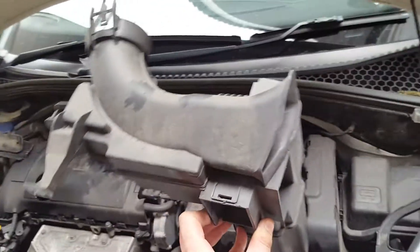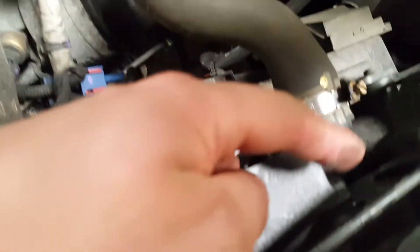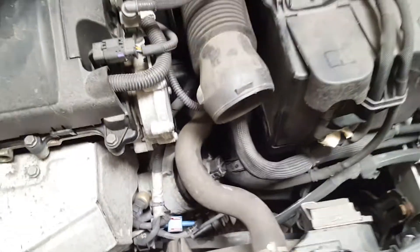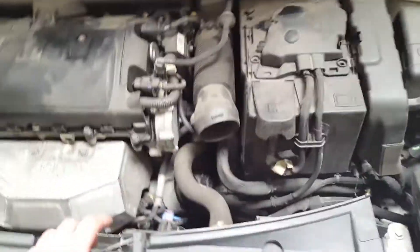The other thing is to get your oil filter, which is there — new 27mm socket on it. But first you need to remove the air induction plastic — it slides down there. You need to remove a little clip that goes in there, then unhook that from that bit there — just get a screwdriver in there and move it, then it comes off and you pull it out. Then remove the oil filter, take it out, put the new one in. Don't forget to put a new rubber seal on it as well. Don't forget to do your sump plug back on as well.